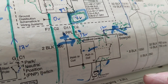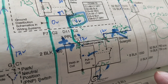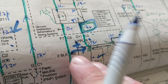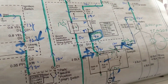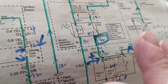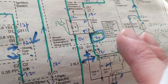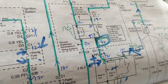Another visual check: look at the clutch fan. If the clutch fan is turning, the water pump shaft is turning, which means the engine is trying to turn over — so it's not a starter problem. If this was helpful, look up the videos on the channel on how to use a clamp meter to measure current, and how to test the alternator — which is a computer-controlled device nowadays. We have to test things differently than we did 20 to 25 years ago. Thanks for watching.